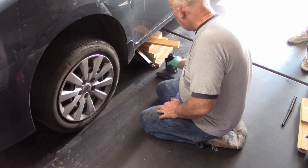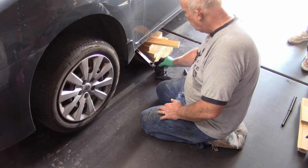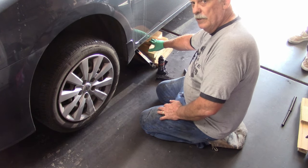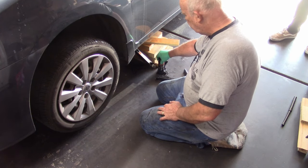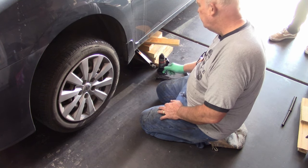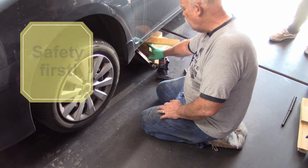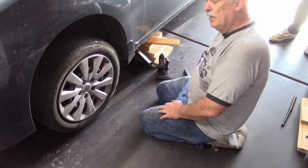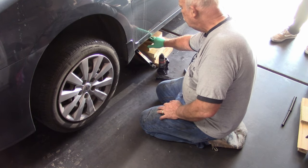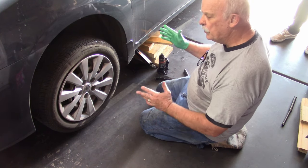A lot of you might have a little hydraulic jack like this one. The problem is the seal can fail over time or the fluid can come out, and as you go to pump it up it can slowly sink. These are not really the best — they're nice and convenient, but they can let you down. This other kind, they call it a scissors jack; it's more mechanical so it's more sturdy. You still want to have something to support the car in case it does fail — always keep safety first. Make sure you block the rear wheels or set the emergency brake so the car doesn't start rolling on you while you're working on it.